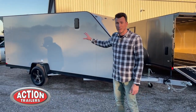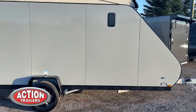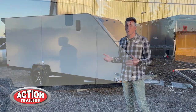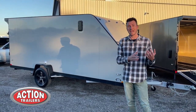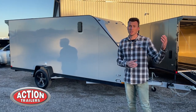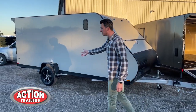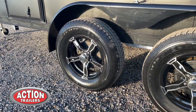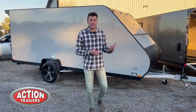Notice on the outside they're all screwless panels, which gives you that sharp look, and the contour on the nose is very aerodynamic. These trailers tow nicely behind your vehicle because they're not as wide — being seven feet wide compared to eight and a half feet as a traditional trailer, which you often see in recreational snowmobile or ATV trailers. They also feature big 15-inch aluminum wheels standard, so you get a larger tire and less bounce. It's also a radial tire, so it's a better overall quality tire.